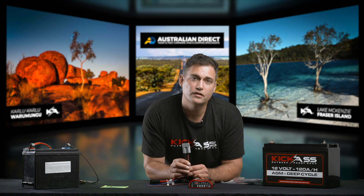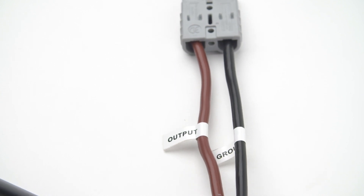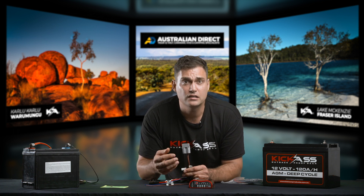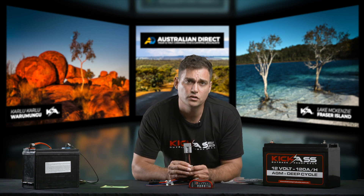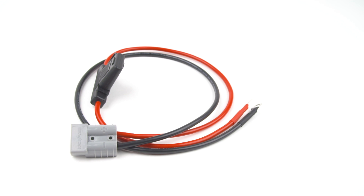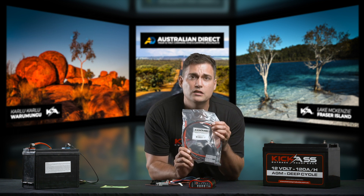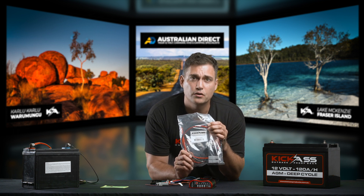It's time to connect the output of the DC charger to your auxiliary battery — that is the brown and black wire and it says output. If you're connecting up to a battery box, just make sure you connect it to an Anderson plug that goes straight to the battery. Or if you want to connect it directly with an Anderson plug to the auxiliary, no problems. If you do want to connect to a battery on its own, I suggest one of these KA maxi leads — you'll see the SKU code on the website.